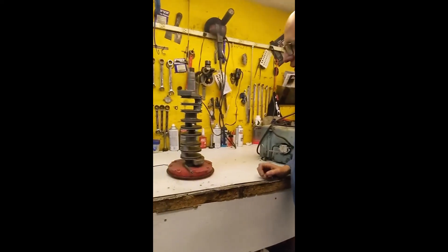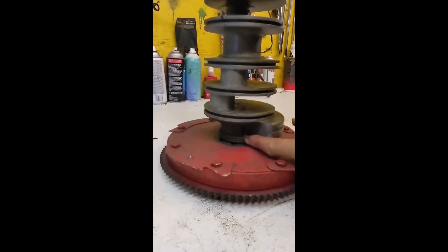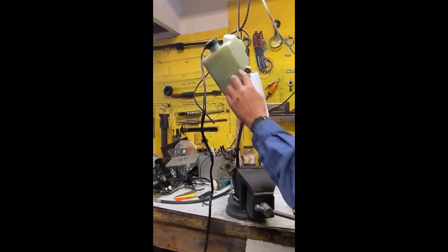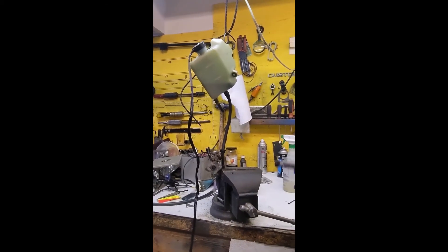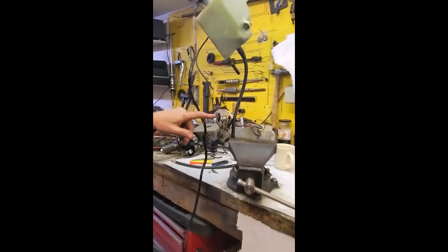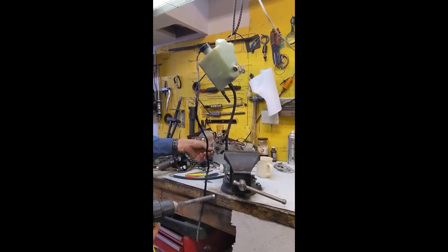This is the guts of how it works. Here we have a crankshaft that would be in that engine — this is a V6. There's a bronze gear right there meshed with this gear, which drives the oil pump you saw in the first video. When we remanufacture a motor, we set this up — this is the tank off the motor. We put some oil in it, we've got gravity feed because we're suspending this. We take an electric drill, in this case clockwise, and watch to make sure oil comes out. The arm is at wide open because that's the arm you saw in the first video.